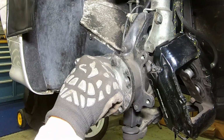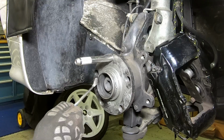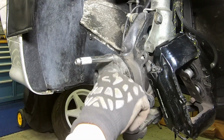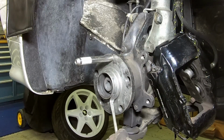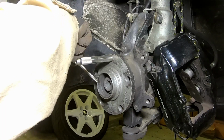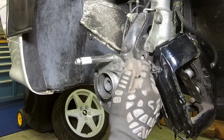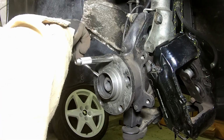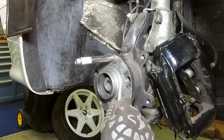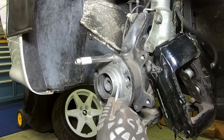Remember, this stuff rusts. If you live in a place that rusts a lot, you're going to get a lot of rust in this area. So it doesn't hurt. The other thing this does is your wheels. Your wheels, most of the time, are aluminum. Well, aluminum corrodes, and your wheel will seize around this area. Not just the rotor back here, but around this area.